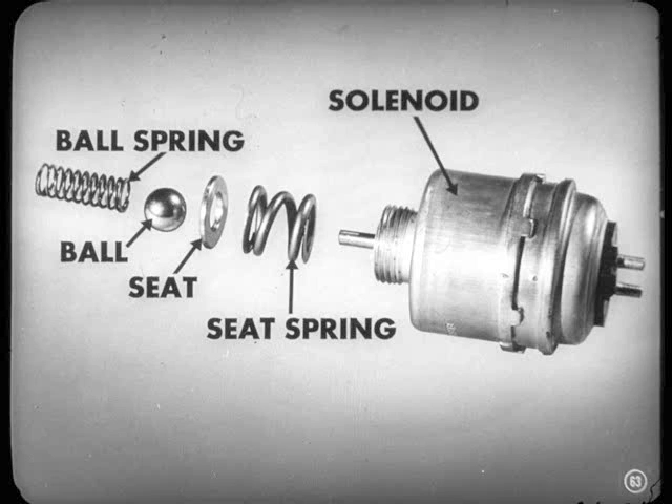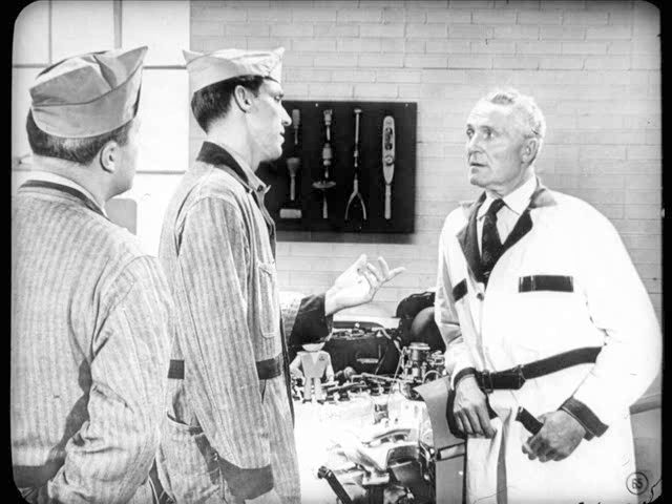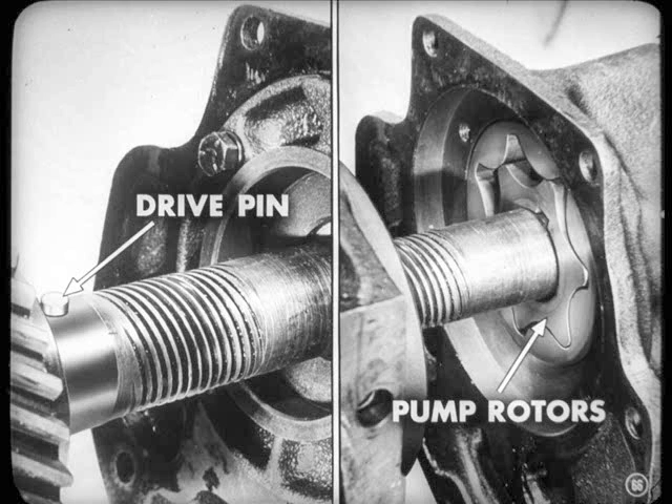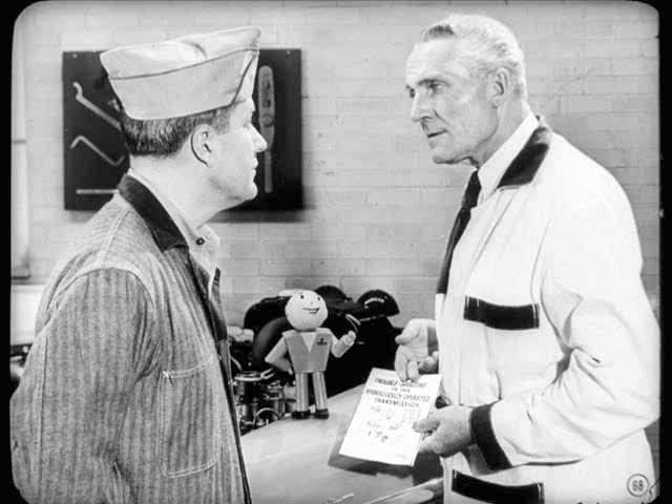The first thing to do is remove the solenoid and check the ball valve parts to see that they're in their right positions. Then remove the shuttle valve and see that its parts are okay. The drive pin might shear off if dirt got into the pump — you can check that pin by taking the transmission out and pulling the extension back on the main shaft to see if the pin is sheared off. You can also inspect the pump rotors for damage, and check for a scored piston ring, cylinder, or piston. If you do have to pull the transmission down, look up the disassembly and assembly tips in the reference book.